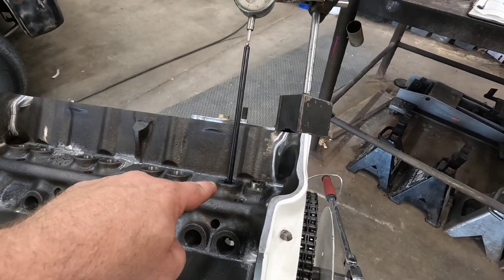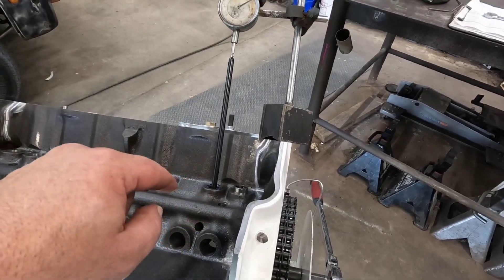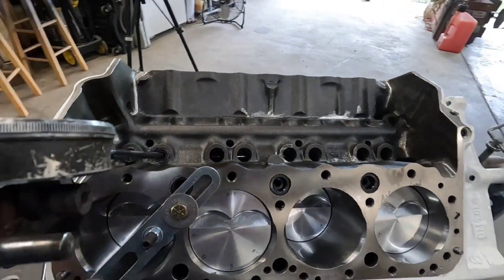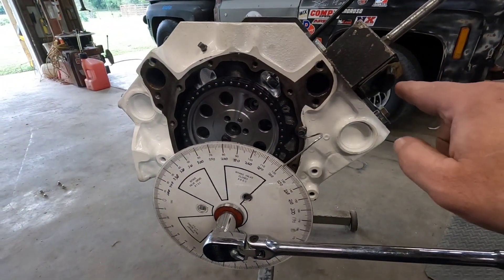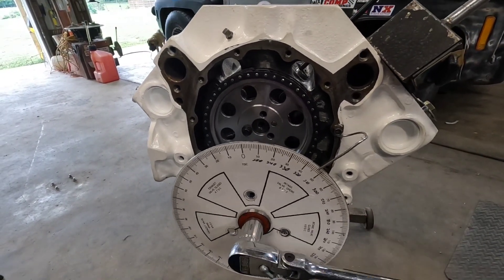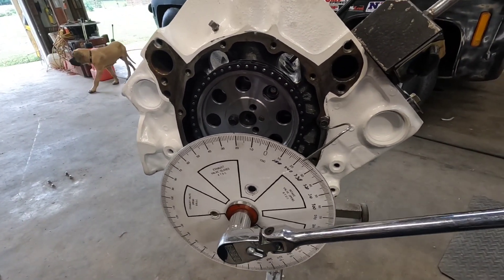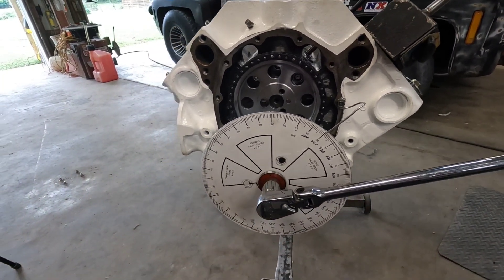My lifters, as you may know from watching my videos, are solid. You also need some sort of a piston stop. You could also do this with the cylinder head on — you'd just need a piston stop that goes through the spark plug hole and get everything set up about the same way. To zero it out, you've got your piston stop and you'll turn it over to where it just stops. Get a little bit of pressure on it — you don't want to hammer down on it and mark up your piston. Then take note of where your indicator is at.